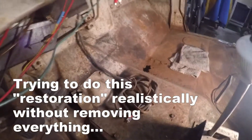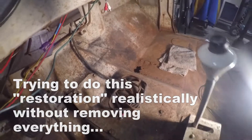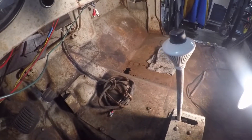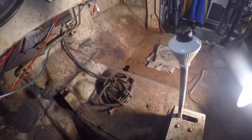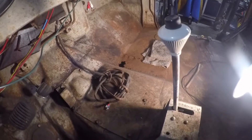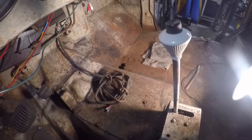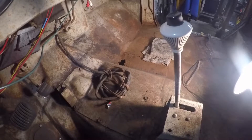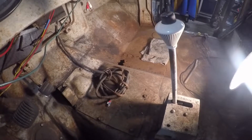Over here on the floor is the next major repair. I think I'm going to grind that out and identify exactly where it is. If I can remember what Fritzi says — he says don't cut everything out, make the patch piece first and then cut it out as best you can — and I'm going to try and follow his advice on that.